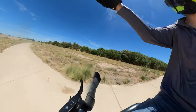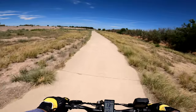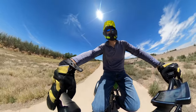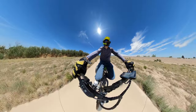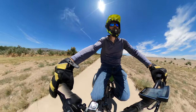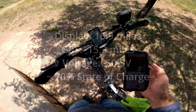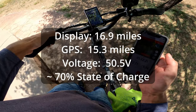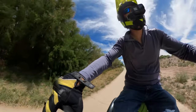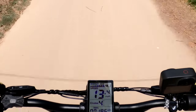One reason I'm doing a throttle-only test is that this type of bike without gears will likely be used that way more often. It's more of a recreational bike — helping people regain mobility, accommodating old injuries, or even replacing transportation for people who can't drive due to physical disability. If you're replacing transportation, you care less about pedaling and will use the throttle more. At approximately 16.9 miles on the trip meter, open circuit voltage is about 50.4 volts. Strava shows 15.3 miles vs. 16.9 on the bike — choose who you want to believe.